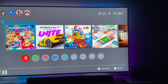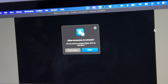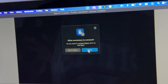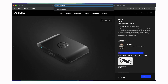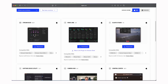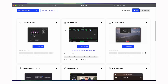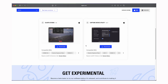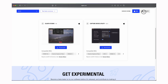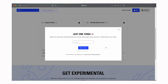Switch is on, TV is on, and when I turn my MacBook on, a prompt popped up recognising the capture card, so I hit Allow. Now, you can capture in two ways. You can download Elgato software by going to elgato.com/download, then filter by system and choose Mac or Windows. You can see the 4K Capture Utility is available for Windows but not for Mac. So Mac users will have to use OBS to capture, but you'll still want the Capture Device Utility for firmware updates.